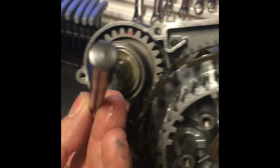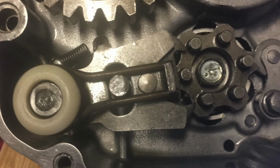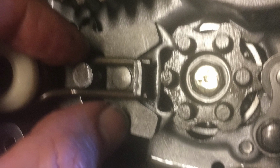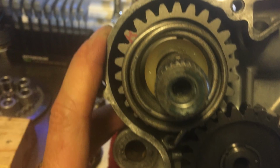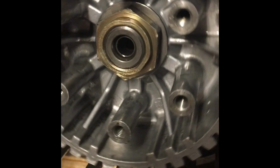That's the Kickstarter. This is the push rod, and from what I can see, it's about the same on both ends. But I even went ahead and marked the point that was going in versus the point that was going out, because again, I knew the bike ran good. We just had this really weird issue with the bearings and the bearing journal. So we had this play in the crank, but it had a brand new rebuilt crank. And so there was something with the journals. And thanks to Mike Weir and Tom Morgan for letting me know that the cases, the little journals where those bearings go in, get worn out. And you got to, unfortunately, rebuild those things and add a more robust bearing in there.